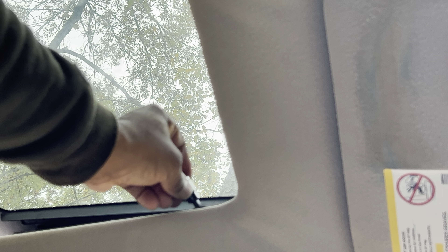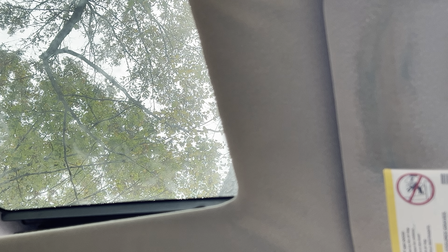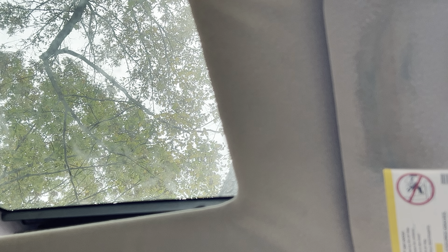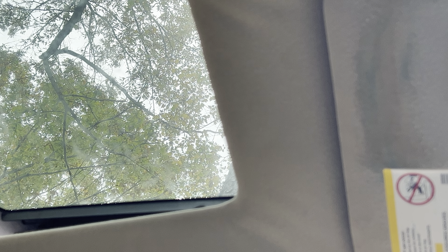Let me open the set now so I can give you that information. The T10 and T15 are really small. I thought it might be a T20 — and the T20 does fit, but it's a little wiggly. I like it to fit snug, so let's try the T27. The T27 is too big. So it's a T20 — a T20 is the size bolt this vehicle takes.